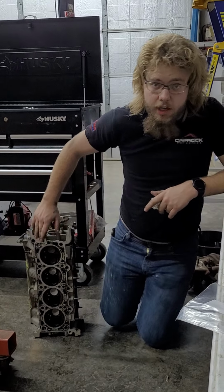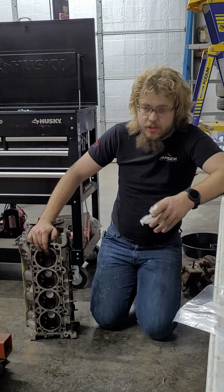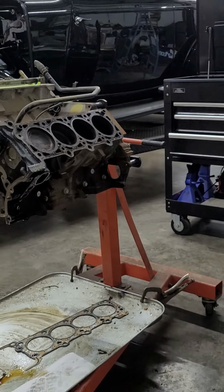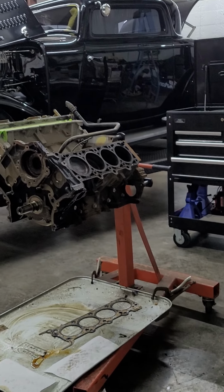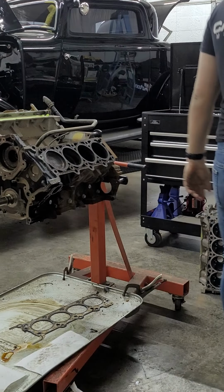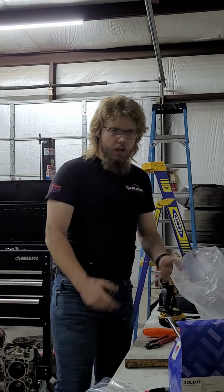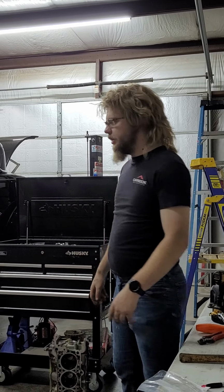You know, I'm running nitrous, so I want aftermarket pistons because I'm scared of the stock piston shattering. But you put these on the flat tops and you get like an 11 or 12 to 1 compression ratio. I think it's 12 to 1. And of course, you bleed some of that off with a cam, but it makes for a really hot setup. Solid 5 to 10% gains, I think, going from 10 to 1 to 12 to 1. So you're talking an extra 50, maybe 100 horsepower.